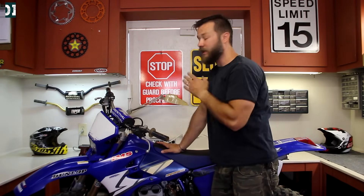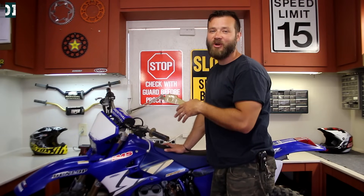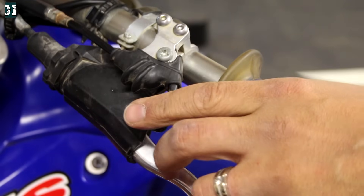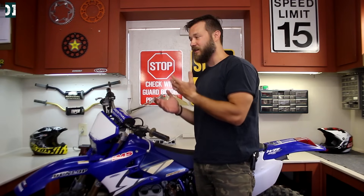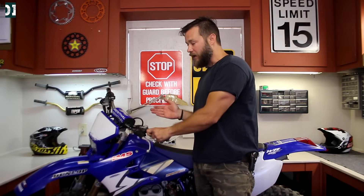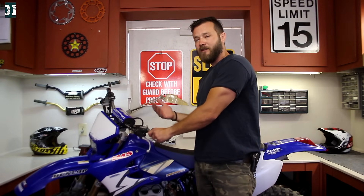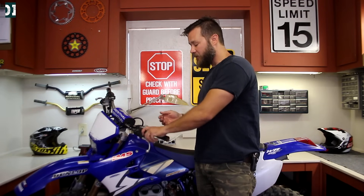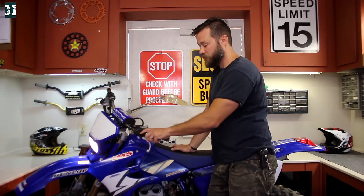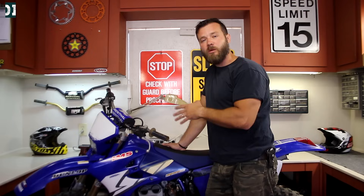This is how you should feel and hear your throttle response when everything is adjusted correctly. I'm going to show you a trick I learned from YouTuber Jake Clark — he's been around dirt bikes for about 40 years and does really good stuff. The hot start, when you pull it in, is the opposite of a choke. A choke restricts air; the hot start adds more air. If the bike is jetted correctly and you pull the full hot start in, giving it more air, the RPM should go up and stay up.